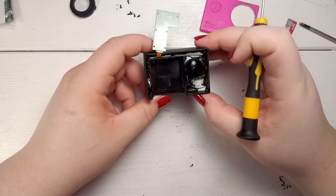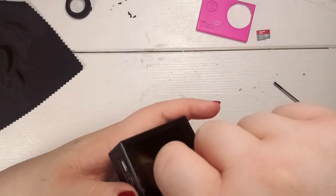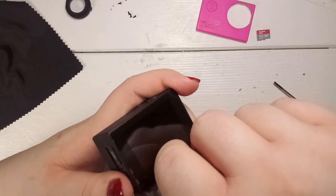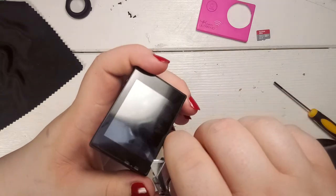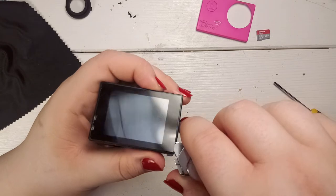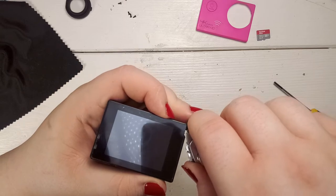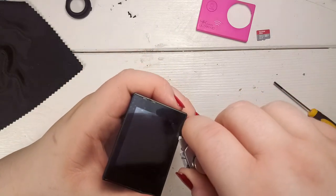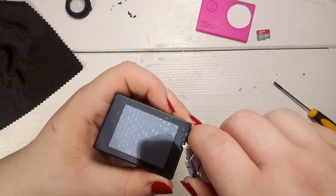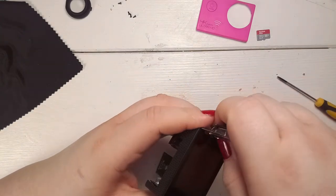At this point it gets a little tricky. There are two types of cameras: the one I have where the screen is glued in place, and one that has a simple transparent cover like the one from the front. If you have the version I got, you need an X-Acto knife to cut through the glue. Gently insert the knife between the transparent screen protector and the enclosure. Don't cut too deep — take your time. Work your way all the way around and be really careful with the LEDs.